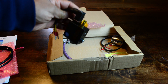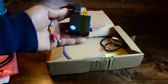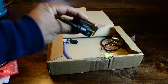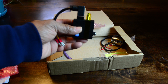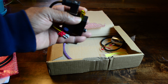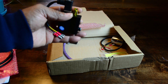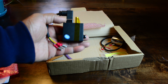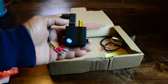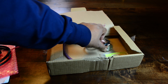This is the meat of the whole system — I'm going to call it the sending unit. It has an input for fuel, and it detects pressure depending on how much gas is in the tank. That pressure is converted to an electrical signal: the more pressure it detects, the stronger the signal. I'm sure it sends that to a stepper motor in the fuel gauge, which moves the dial and shows how much gas I have.